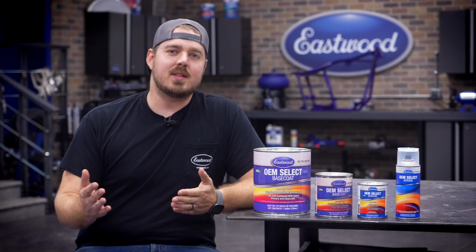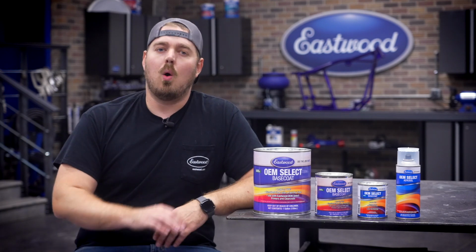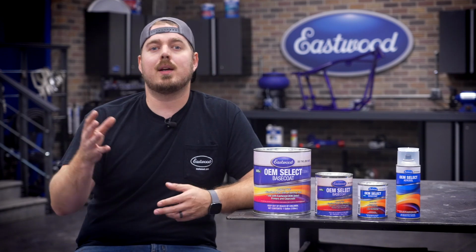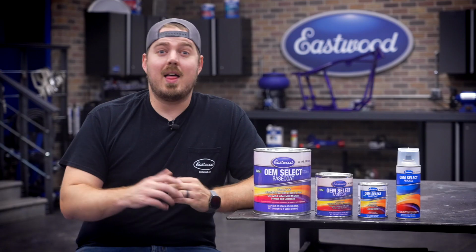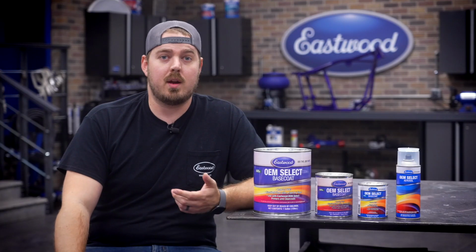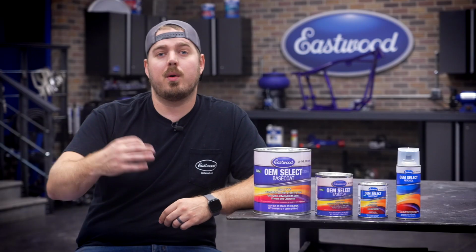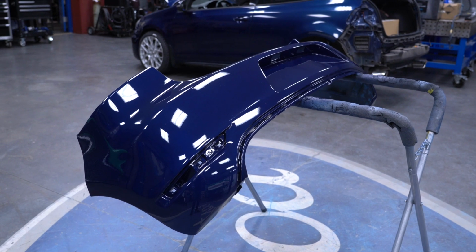If you plan to go with a single stage, then you will need an activator as opposed to a reducer. Again, only use an activator with the single stage urethanes. You will also need to pick a speed for this. The same thought process applies. The hotter the environment, the slower you want the activator. The last thing you need to consider is which clear coat to use, such as our show car 4-to-1 clear. We have a couple options if you're spraying ready to spray or unreduced base coat. However, no matter which option you go with, you will need a clear coat for them. Again, if you choose single stage, then you do not need a clear coat.